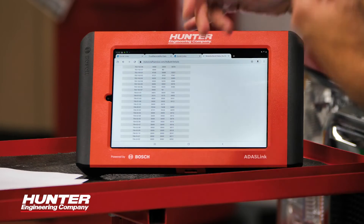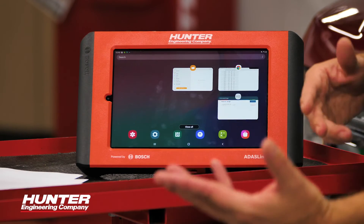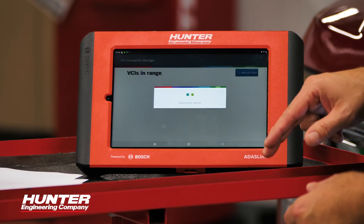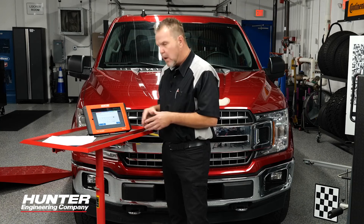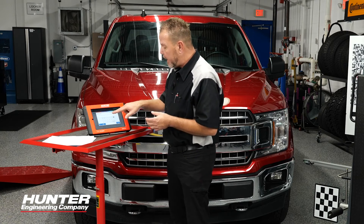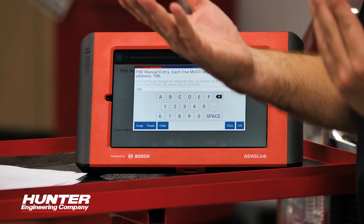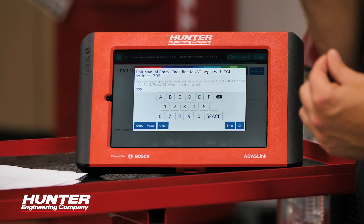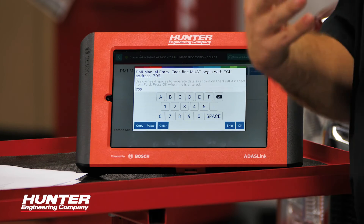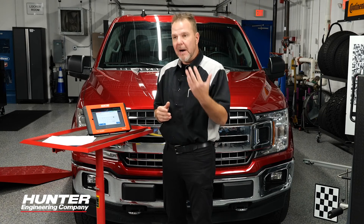706 is my first module. It might be easier to write it down or print it out every time you're doing this. Now that you have the correct as-built data for your vehicle, you're going to go ahead and enter each address as it is on the as-built data screen, line by line, using spaces and letters appropriate to the vehicle that you looked up. Once you've completed each line of data, the module will be successfully written to the vehicle and then you can go ahead and calibrate it.